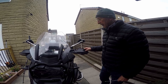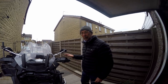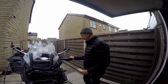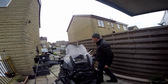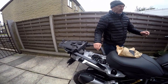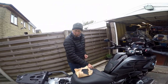When I installed it, I didn't want to drill the hand guards or anything like that. Any biker who drills through the center to run cables — I just wanted to put it all on and take it all off without damaging anything. I didn't want to wire into the turn switch circuit either. So the plus side of buying all the right gear is it's essentially plug and play, but you will struggle for room in the back. I used three of the four circuits, taking three wires from each of the indicators and the running lights down and then running a pair up through there.